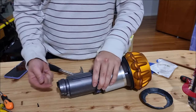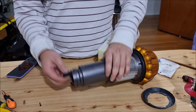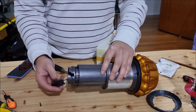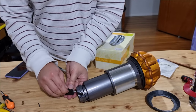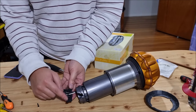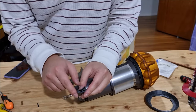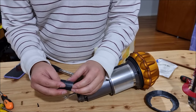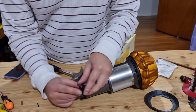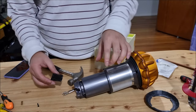Now that I've knocked it out, here's the connector. As you can see, it comes out a bit — that's why you can't do it on the table. For the V11 and V10 you could, but they changed it. The connector comes out from the top. You can open the flap. The white cable is on the inside where the hinge is, and the black cable — the negative — is on the outside where the opening is. As you can see, the two corners are broken, and there's also damage from knocking it out. The two corners will break and that's the idea — you need to break the two corners so you can push it out, or else it gets stuck inside. But even with it broken, you can push it back in since the cables will hold it from falling out.